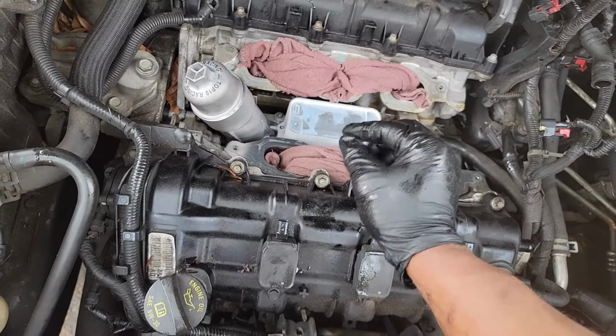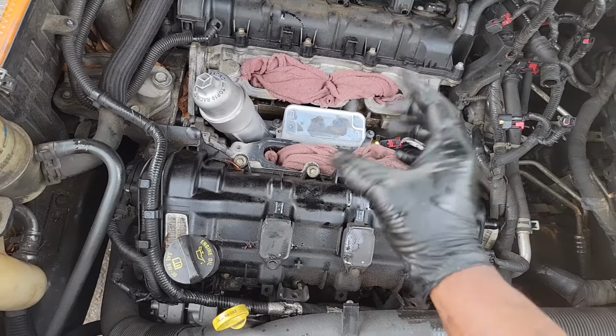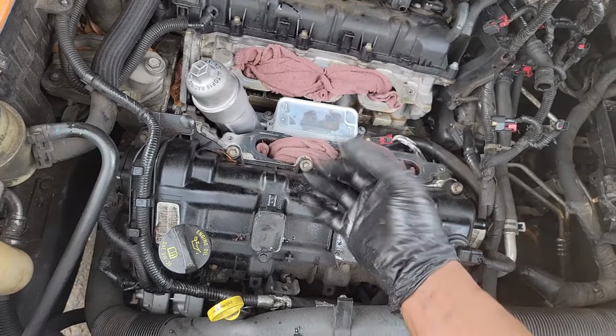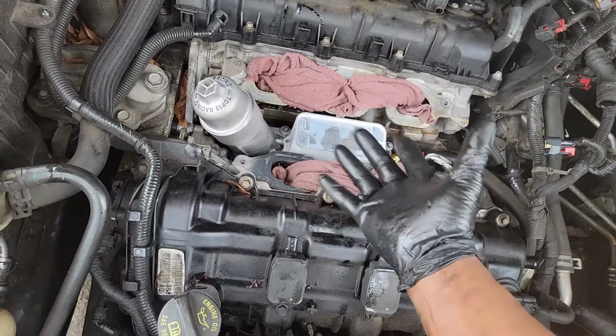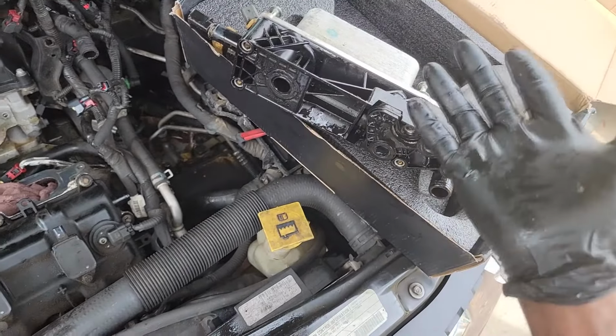If these seals get compressed to the point where this is touching the block, just like this one, it would eventually warp. Okay, guys, heat attached to a heated item or a hot item attached to anything would cause that anything to deform or make it not normal like it used to be. This is aluminum. It may warp. This is plastic. It may melt. In fact, it will melt.